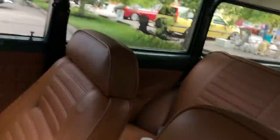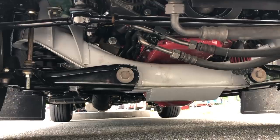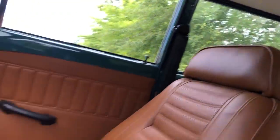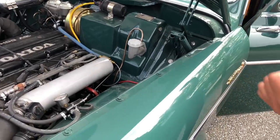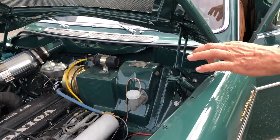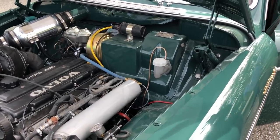The turbo sits really low - there's so much room in those 740s. For the sump, I had to modify the crossmember, then take a B20 oil pan, cut the sump out of it, cut the sump out of the original, and then modify the oil pickup too. Everything in this car has been messed with - there is nothing that has not been modified. I even had to modify the steering column - I had to move the joint and shorten this section. I used a GM collapsible column from a GM car, stopped it into the original Volvo hub - all the splines are still Volvo. I machined and welded it all up so it does collapse.